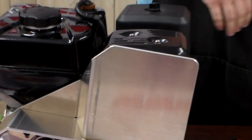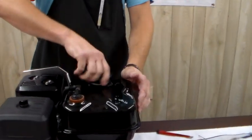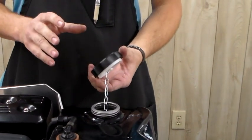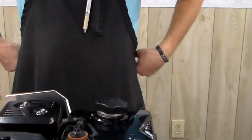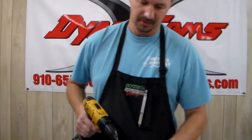Get both bolts tight — now we're done with our chain guard. Next you're going to want to vent the cap. These come equipped with a plastic fuel cap, and for service use they're vented just fine. But when we're racing we're turning this thing around 5,000 RPMs, which is a good bit more than the factory designed it to run, so you get what's called a vapor lock effect — your tank can't vent itself.